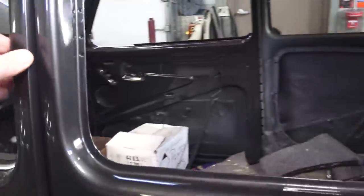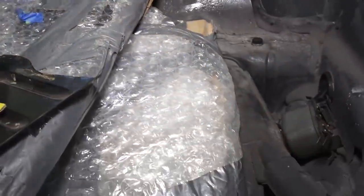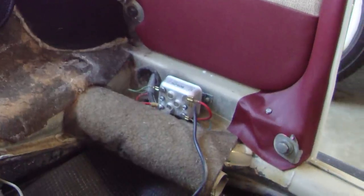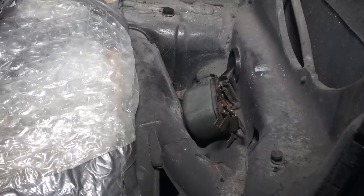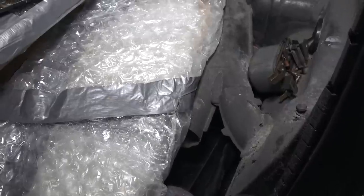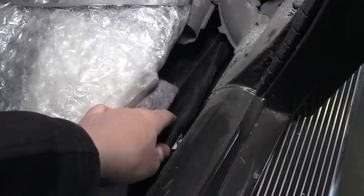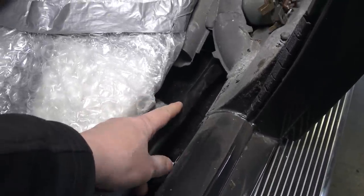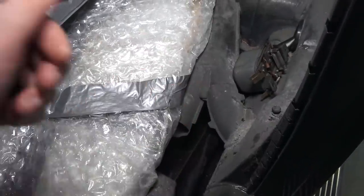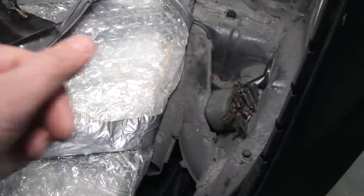I'll show you here — see where we have the regulator mount. I'm going to mount the regulator right there under the back seat. That's the proper way to do it, just to keep it out of the way. Download a '67 schematic and you can hook your regulator up. I have my wiring harness here — right here's our wiring harness. What I'll do is cut a slit in the harness, open up the wires a little bit, connect the proper wires to the regulator, and then the rest will feed back out into the engine compartment.